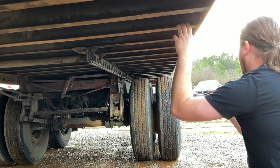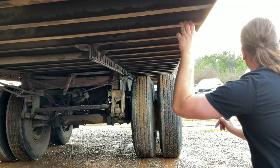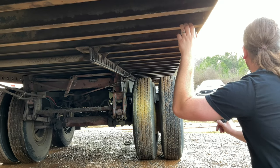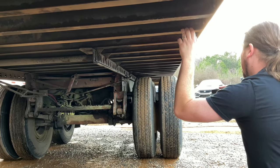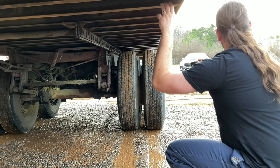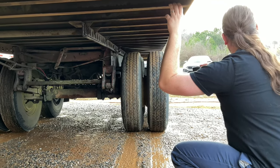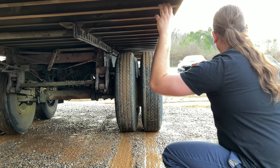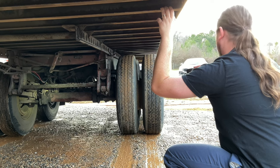I have a torsion bar. It's securely mounted and not damaged. But this trailer does not have shock absorbers nor air bellows. For my brakes, my hoses are not cracked, frayed, or leaking. My brake chambers are securely mounted, not leaking. My slack adjusters have no broken, loose, or missing parts. My pin and cotter pin are in place, securely attached to the push rod.